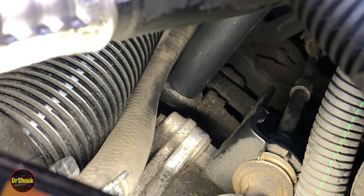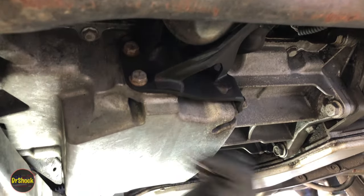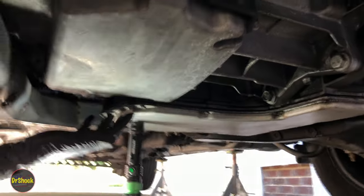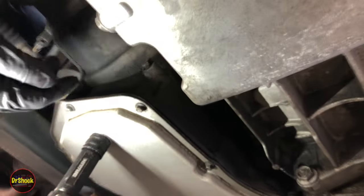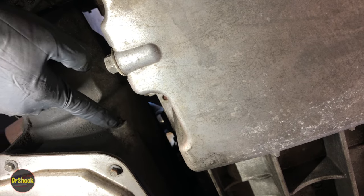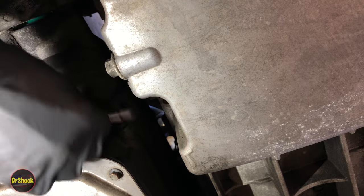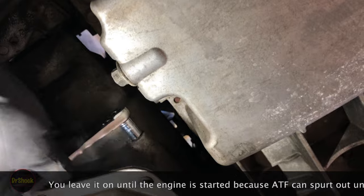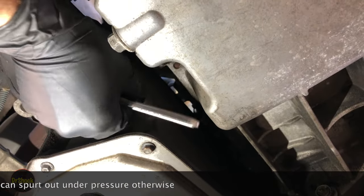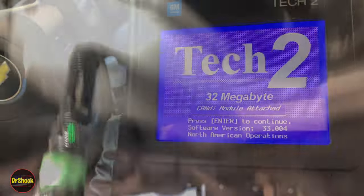Make sure that funnel is seated all the way in so we don't get any splash-over. Underneath the vehicle: here's the bottom pan of your engine where the oil is, and this L-shaped pan is the transmission pan. Over on the passenger side of the L is where we'll find the check plug — it's an 11-millimeter plug right here. Before starting the engine and warming it up, we're going to go ahead and crack the torque on this to make it easier to remove. We'll leave it on but loosen it now, because when everything's hot it'll be harder to do.